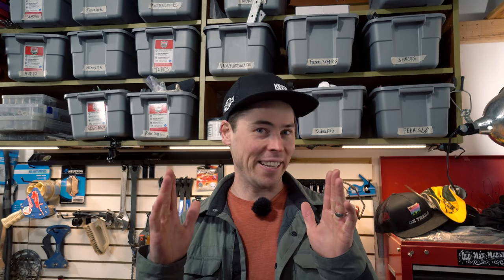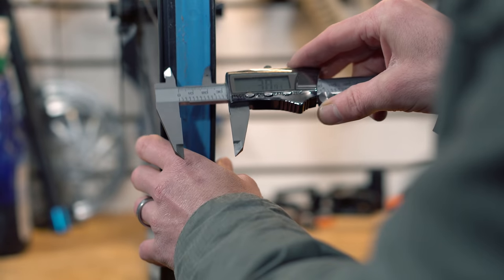Over the last few years, rims have gotten way wider. We used to just grab a tire and squeeze it as a pretty good indicator of 25 or 30 PSI. But as rims got wider, tire sidewalls became more vertical and much stiffer. Once you get over about 30 millimeters of inner rim width, you can't rely on the old squeeze test. Never exceed the recommended maximum tire pressure on your rim or tire — especially if running a non-tubeless-compatible setup, where the tire can explosively blow off the rim.